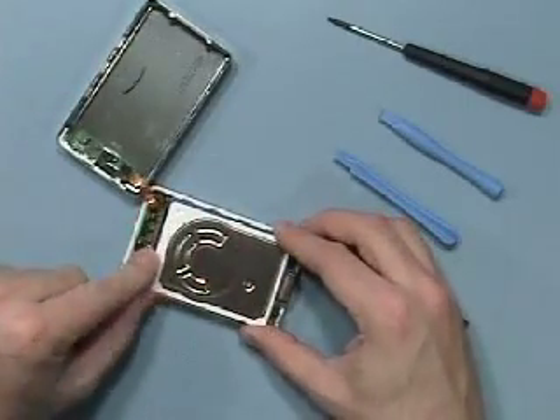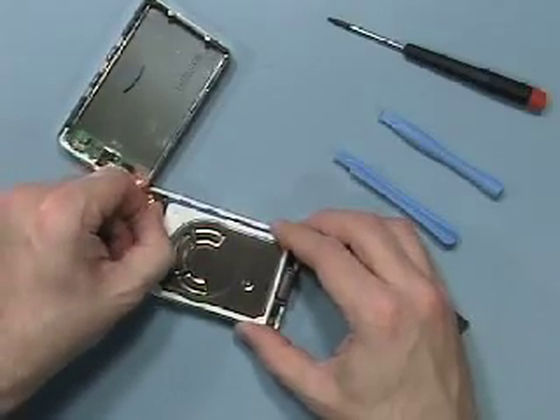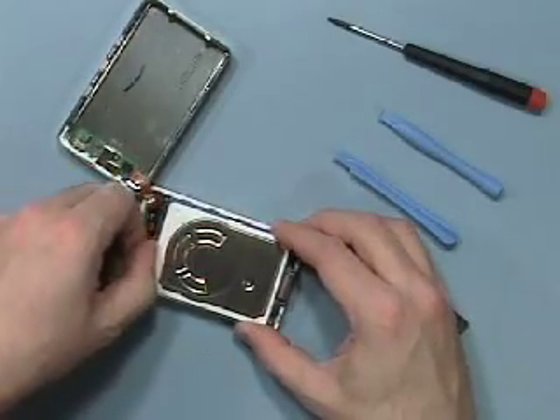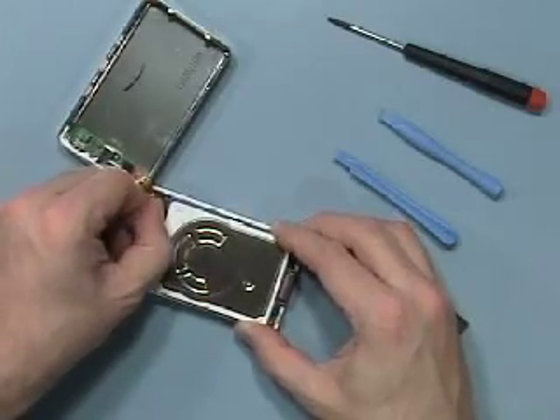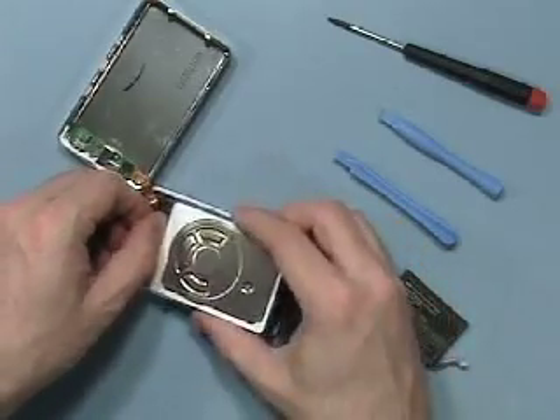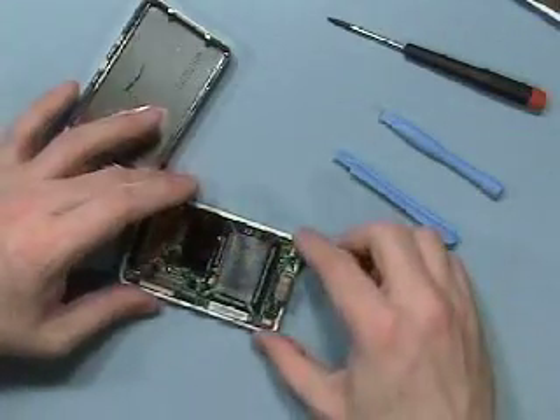You'll need to remove the hard drive. You'll see the hard drive actually has its edge connector up at the top. There's a little black wire attached as a pull mechanism. Gently remove the hard drive — lift up on it and it'll come right out. You'll see the hard drive connector.